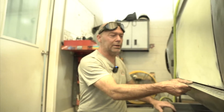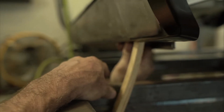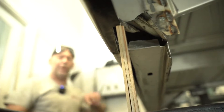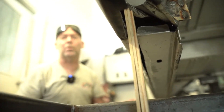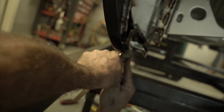There's the right way and the wrong way — you get the metal straight first, put a skim coat of bondo, and then you're done. This one was really out to lunch, so we put a big slice across the whole bottom. I have some paint sticks holding it where the quarter and rocker should be. I'm making a little patch — part of it is here — and it's going to slide in, fill the gap, and get welded up. You'll have a nice solid all-metal panel with only a slight skim of bondo for the small wiggles and wobbles.